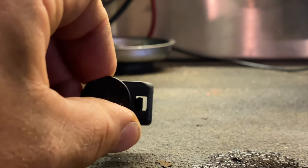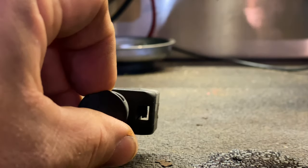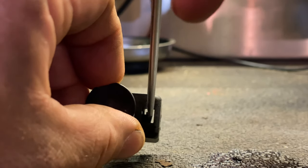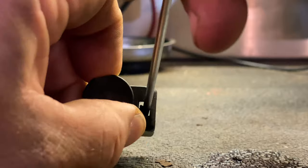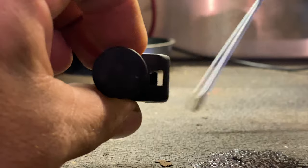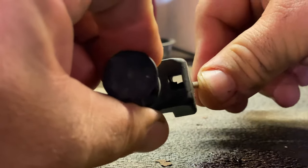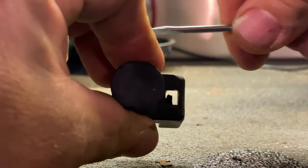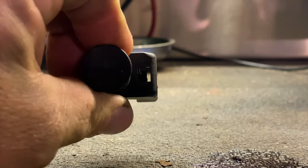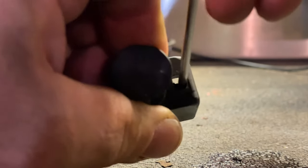What we have to do is insert a thin screwdriver or a pick tool, reach in on this side of the clip, and just pry it a little bit away. You want to do it from the front. Press this clip so it can release from the metal. Once you've got it pressed in and push on it a little bit, you can pull this off the tube.